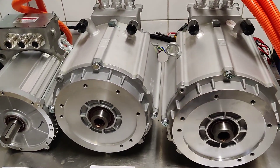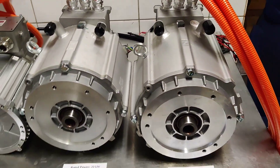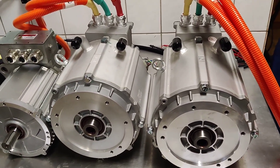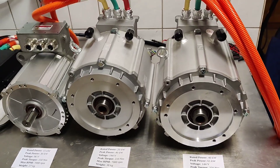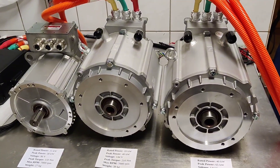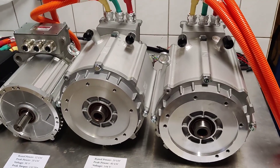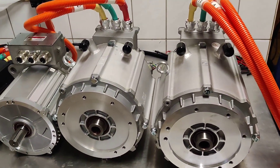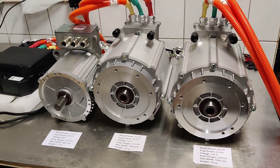In most cases, for daily city cars in Europe, these two mid-range motors use 45 to 48 cells, which cannot fit entirely in the engine bay. That means you need at least two battery packs — splitting the battery into two locations. One will likely be in the front engine bay where the engine was, and another under the car or in the trunk. Sometimes it's even necessary to have three locations for the battery.